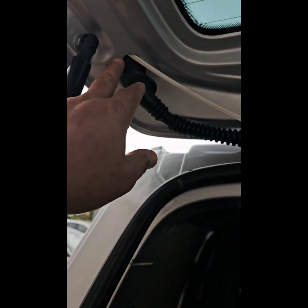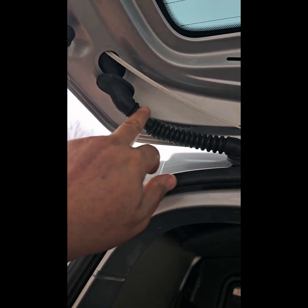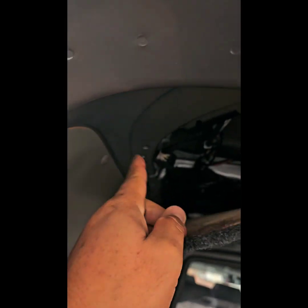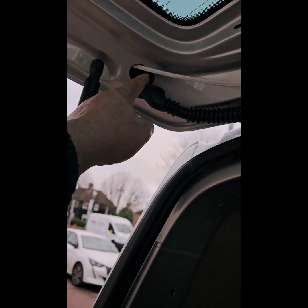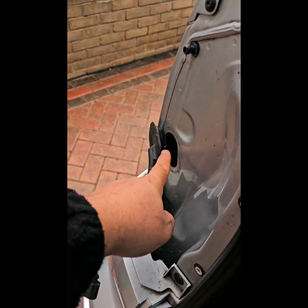So I took the grommet off. So the cable will be coming through here. This is my fishing line that's going to come through. I partly took down the headliner. So the cable will be running from here down to the head unit. So that's already removed, the light's already removed. And the cable on the fishing line, fishing rod, or whatever you want to call it, is going to come through this into the grommet there and go down. The yellow cable is going to come right down here, the pillar, and here the brown cable.